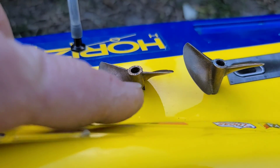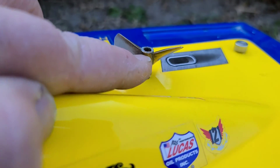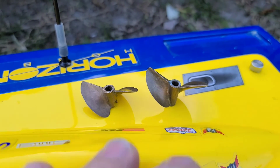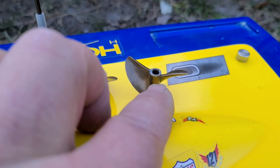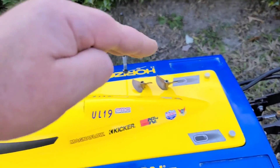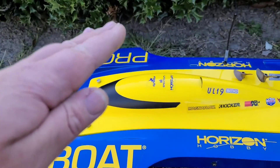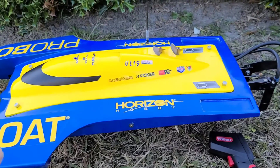The Octura 642 has little to no rake. The rake is the angle the blade comes off the hub — you can see how this one has some rake. This is a 17-16 cut down to a 42mm. A propeller with a rake tends to keep the bow of the boat down, or lift the aft, depending on how you want to look at it. A propeller with little to no rake tends to lift the bow. We should see a huge difference in ride attitude with the boat.